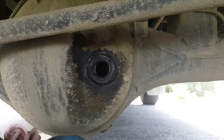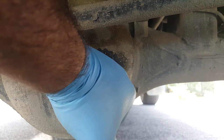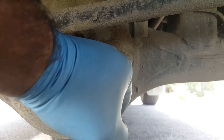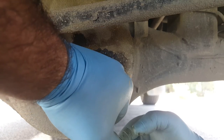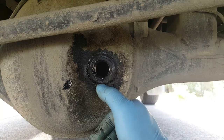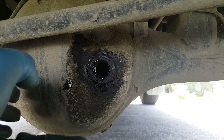It's probably a little bit low. What we need to do now is just pop your finger in, just to see — oh, that is quite low. Oh, there is oil. So it's not too bad. It's pretty clear. It's just a little bit low. It's about at the bottom of the weld there — so we're about five mil low. And this is going to need a bit of a top-up.